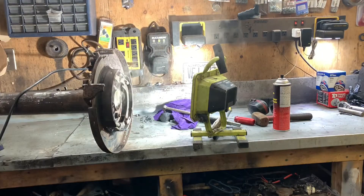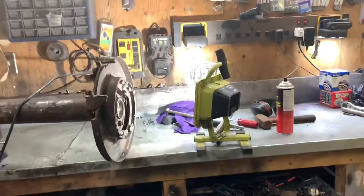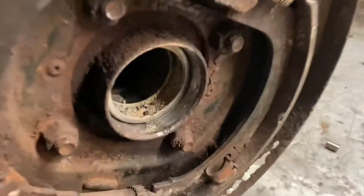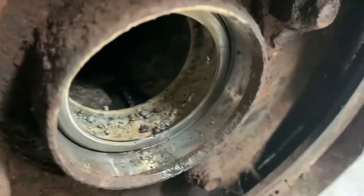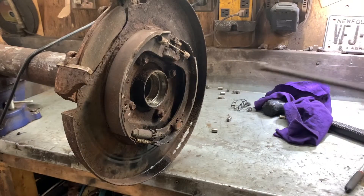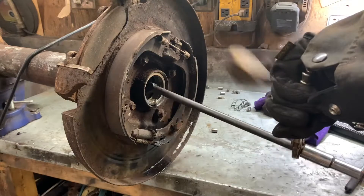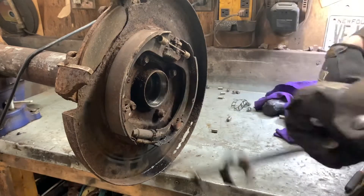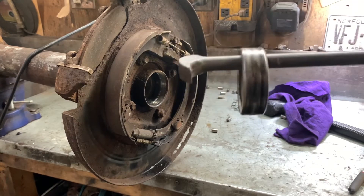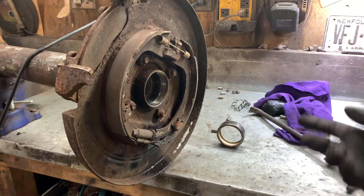This is burning gear oil and it's not really good for you, so have a fan on. When you get smoke that's yellow like that, that's a lung killer. You'll have to excuse the fan for a second, but we can see that I got it welded - it is gross looking, it's just flux core, and I gotta run on low heat. We're not trying to weld anything, we're just trying to make heat. Look at that - it came right out while still hot. I'm going to skip the old time-lapse footage of me whacking on this with the sawzall - just two smacks and it's out.